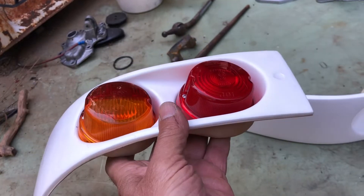A lot more complicated than it looks, but it's only a few very lightweight simple bits as you can see. We're going to run a ground on one side from the housing — this plastic housing has a ground strap side to it — and on the other side we'll run a tooth washer and a ground, connecting both grounds to the existing wiring loom and running it to the body. That'll essentially be grafting the standard remains of the wiring harness, which wasn't too lovely down here, but we're revising it and mounting it into these Hella fixtures as cleanly as possible. Those tiny holes are the wire holes — on this side I'll run a slightly bigger one for the existing terminal, but it all works out nicely.